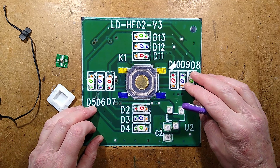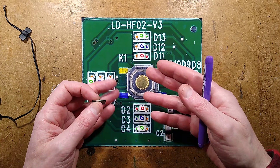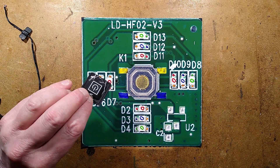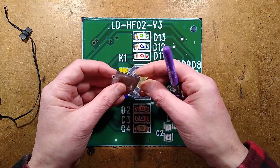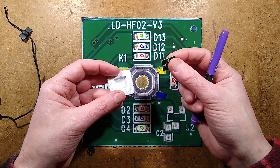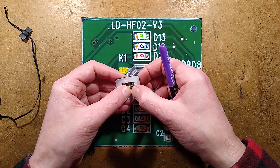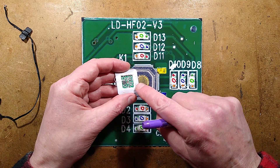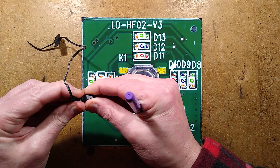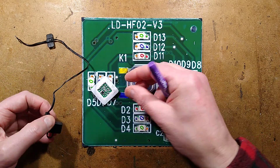Reverse engineering is complete. Let's explore — we'll start with the clean side of the circuit board first. It was very hard to reverse engineer because it had been potted in silicone. They've got this little silicone body with a piece of hard plastic inside just to give a nice clickable surface. The circuit board, after having the wires put on it, is physically clipped in and potted in a silicone compound, making it fairly wash-proof. They do say this thing is washable, and the USB connector has a very tight-fitting cap, so maybe it is water-resilient.